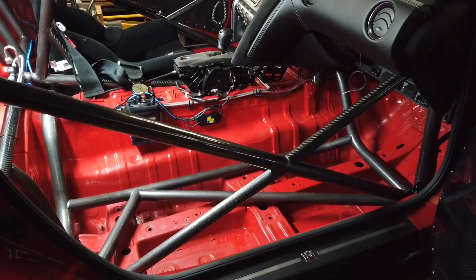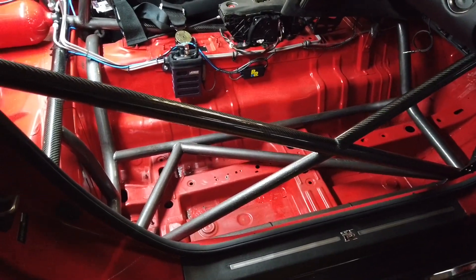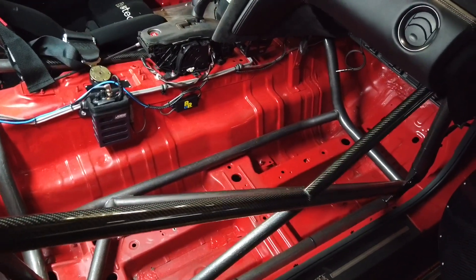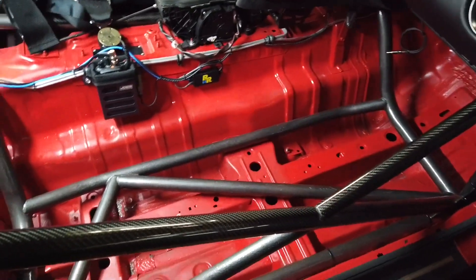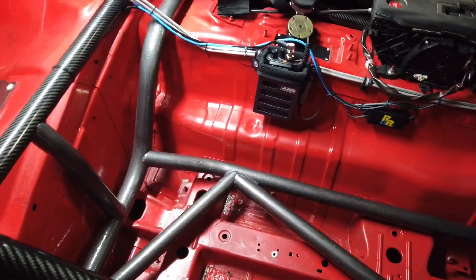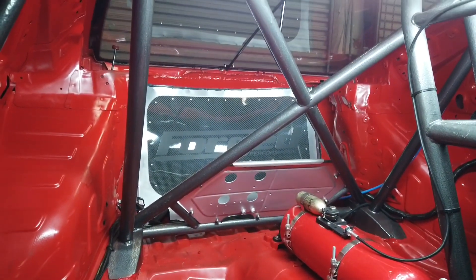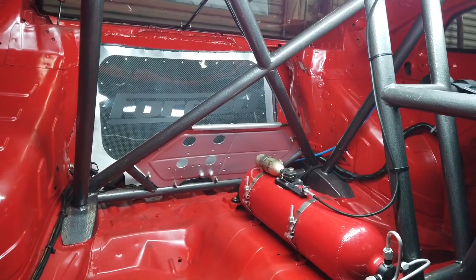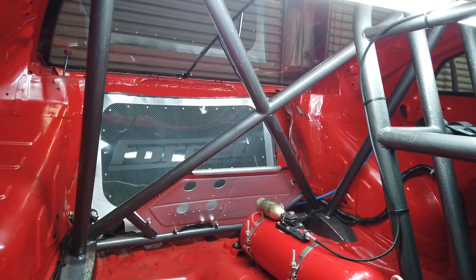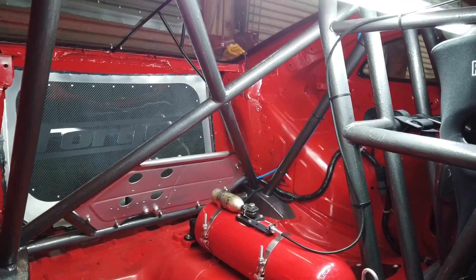It's probably easiest to start off looking through the passenger side to give you a better idea of how much work goes into putting one of these cages in. You can see all these bars here meet the requirements. I know a lot of guys are able to work around some of the rules in the SFI book, but we went ahead and put every bar that was described in there. The floor has a few extra bars for triangulation. Coming around to the back, I'm required to do the two down tubes in the cage, but after doing a little more digging in the rule book, the length of those tubes was a little too long for the diameter, so to meet the requirements we had to add the cross brace in there. Anything that makes the cage more structurally sound, I'm all for it.